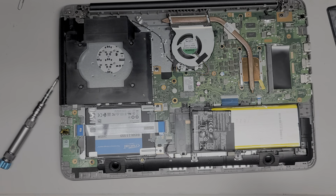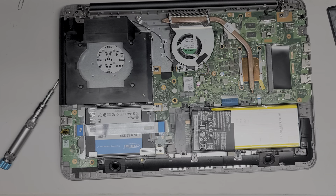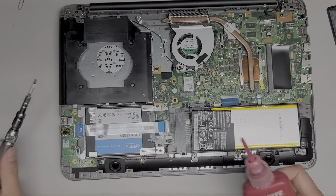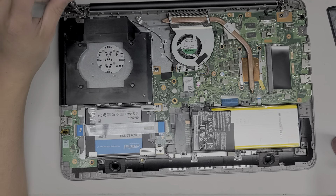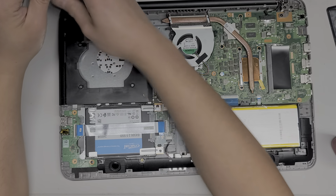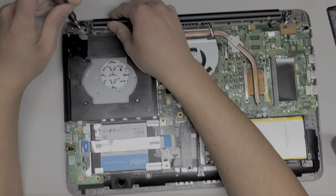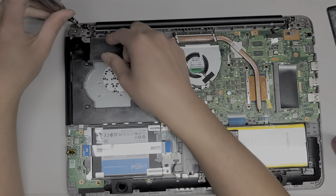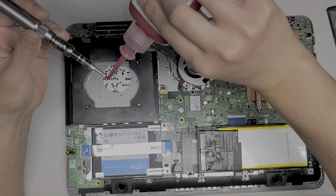I'm going to clean this up — it's clogged for some reason. I'm going to add some thread locker and do this to all the hinge screws just to be safe, because you don't want these hinge screws coming out. I thought some plastic was breaking, but it looks like it was actually a hinge screw. The person that worked on it before must have just left that loose in there. We're going to tighten this up.